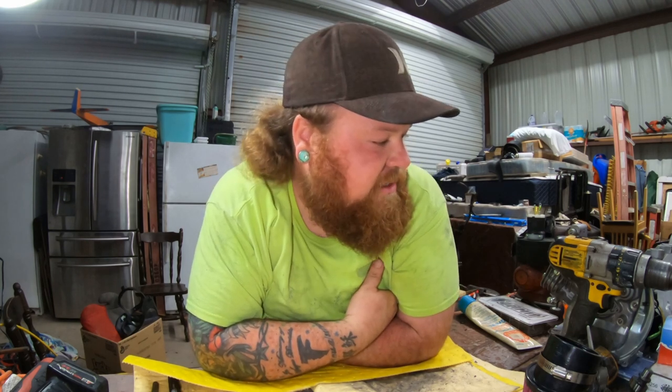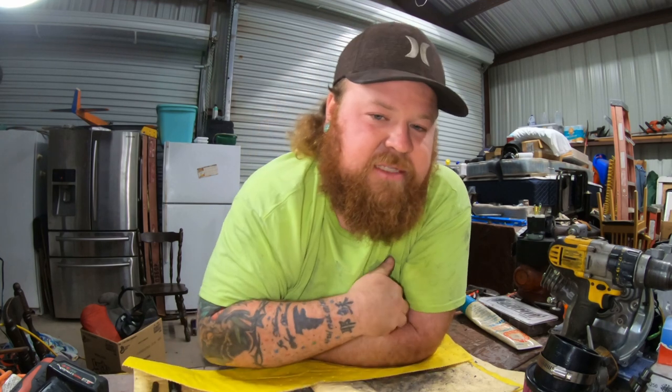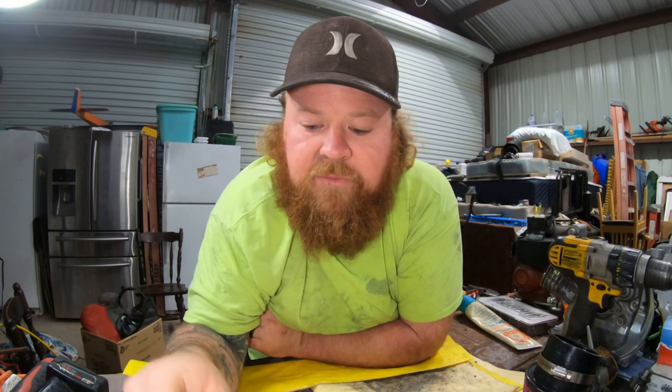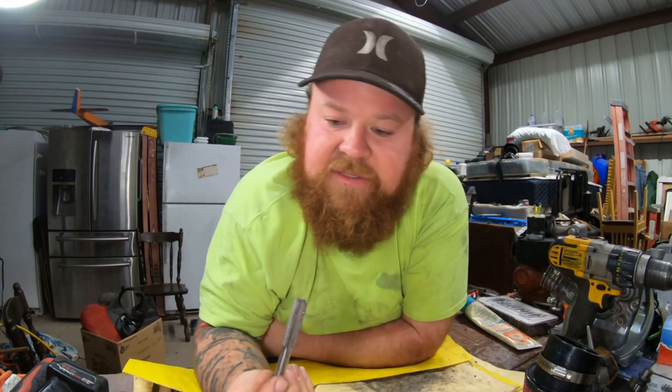Alright, that is it guys. The head's complete. We did a mild port and polish on it, got the 22 pound valve springs in it. We got the case done as well. We got the governor arm that goes through - that little piece that comes out the top - the hole on it is plugged. I used my hammer and a little punch, knocked out the pin that was in it that held the gear on for the governor - it is also plugged. The oil sensor hole is done too. I used a 7/16ths tap and a bolt, ran it through, Loctite on everything. All that is plugged up and done.